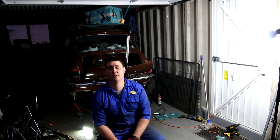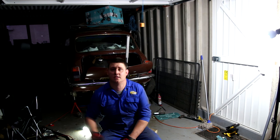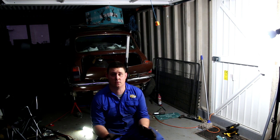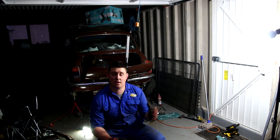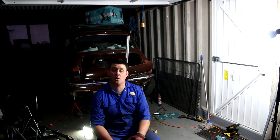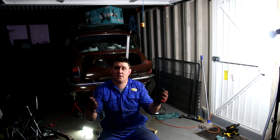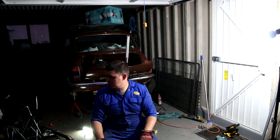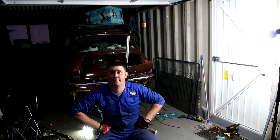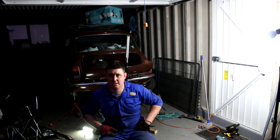We're approaching the final steps of removing this subframe. It's held on by one bolt currently this side and then the stud on this side, so at any point now it could fall. I'm hoping I can get this bolt here out. I've put the trolley jack there with a piece of wood supporting the back, and I'm hoping I can get that bolt out and slowly maneuver the subframe down and back with no issues. I haven't got a piece of wood long enough to go from one side of the subframe to the other, so I'm going to have to try and wing it — but I think I've got this, hopefully.